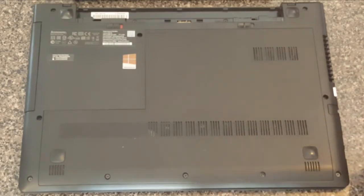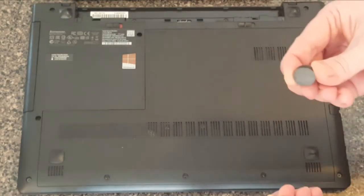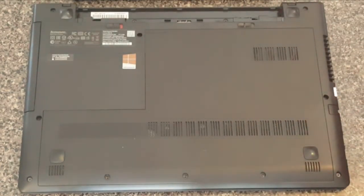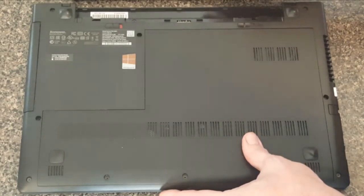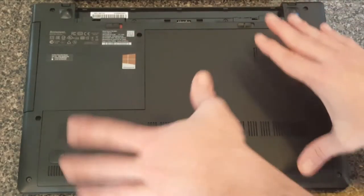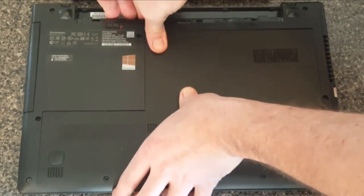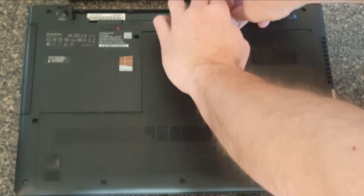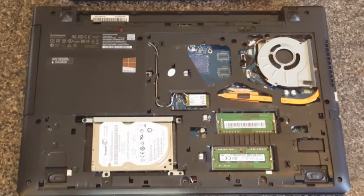One screw cooperated; the other two didn't. For electrical purposes, it's probably not a good idea to use a magnet to pop those out. Now you take this piece — you can see right along here there's a little arrow that points downwards — and slide it off. It's very easy. Now that we have it opened up, we're ready to get to the RAM.